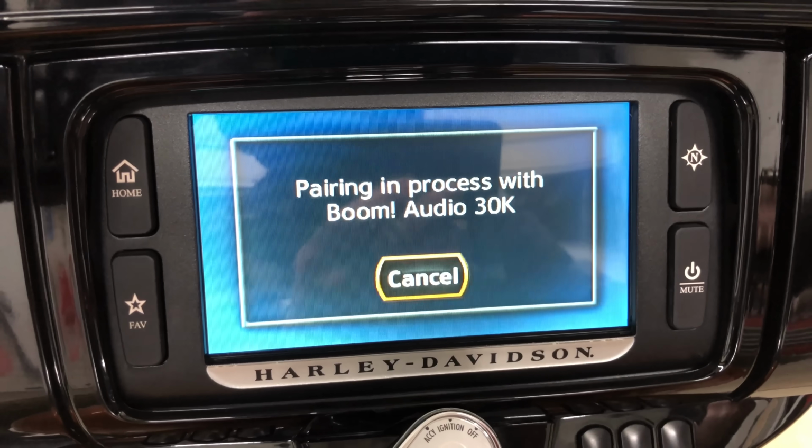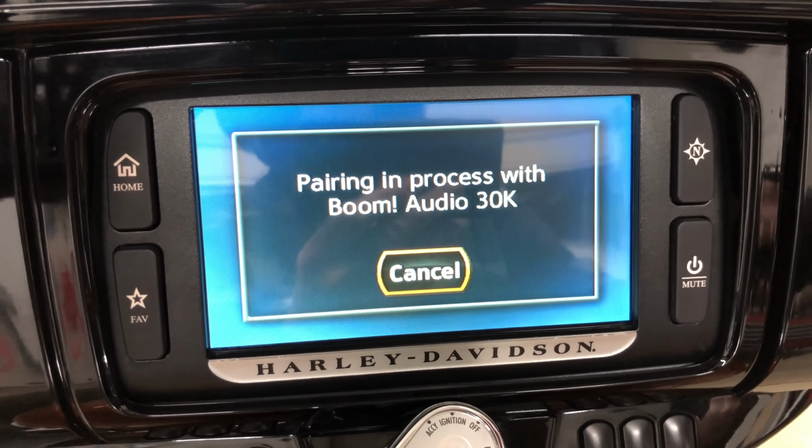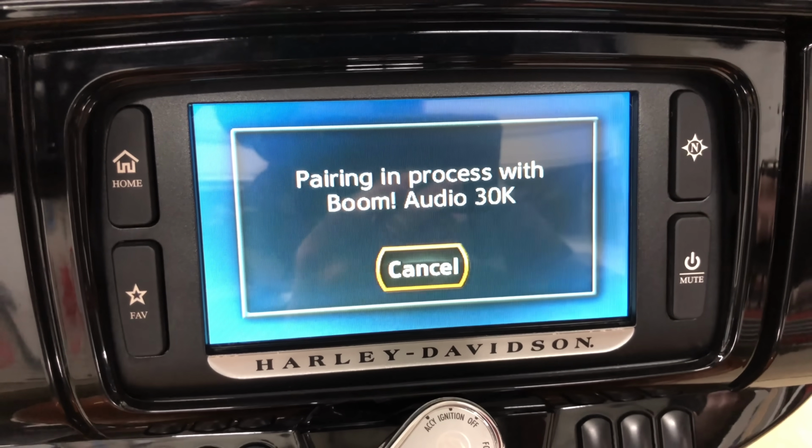And the interesting thing is when I would actually pair a headset, it would tell me that it was paired. Audibly, I could hear it. And the pop-up on the Boombox screen would just say that it's pairing, and it would stick there and would not go away. You'd basically have to back out of the menu system to get rid of that screen that was stuck there. So next, I went into my Boombox and I actually reset my Boombox to factory settings.